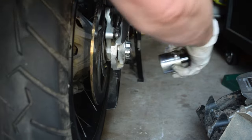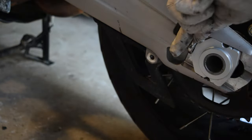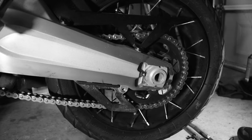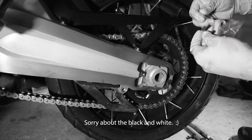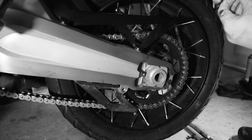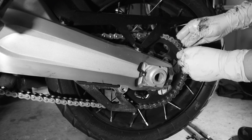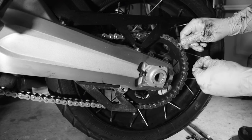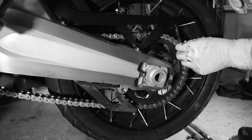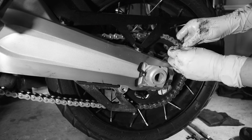You will need to loosen the axle and the push bolts on both sides so that you can get the new chain installed. You then thoroughly grease up the new master link and o-rings, then install the master link half. Then grease up the o-rings for the other side and install. I then place the master link face plate and use the press tool on the DID KM500 tool that I purchased.